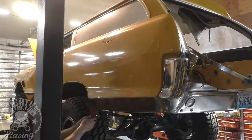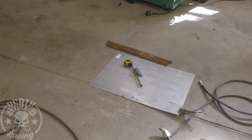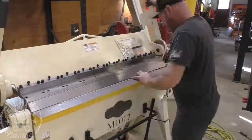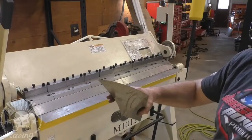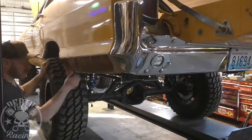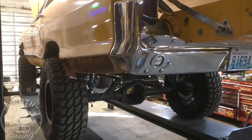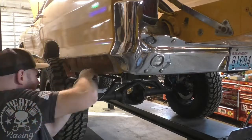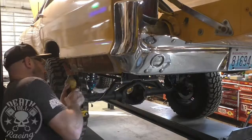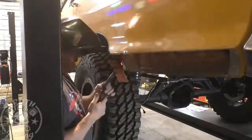We're obviously cleaning it up now, but we're not going to try to paint it right now because otherwise we're going to be messing with our ability to weld very well. I'm going to stitch the whole panel in with TIG. I tacked it on with a MIG welder, and then I stitched it in with TIG welds, and then I went through and actually welded it with silicon bronze. It was the first time I've ever done that, and I did that through MIG. So you use a pure argon gas and weld it up with MIG. I got the curve just right.